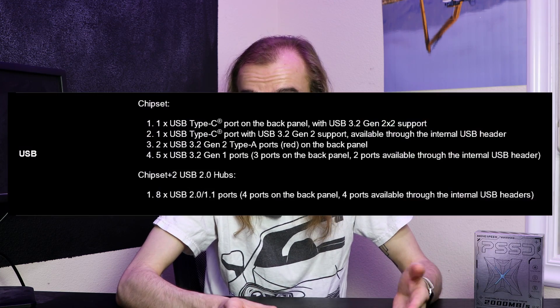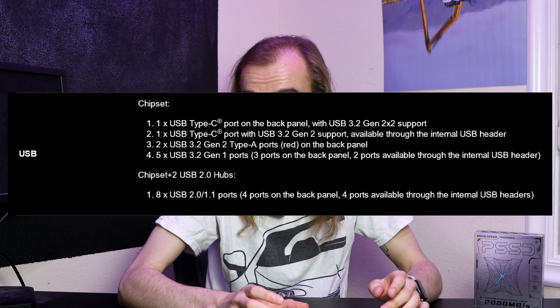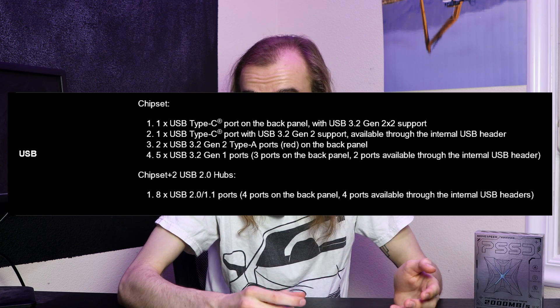Before I look at the performance, I want to make a quick note about USB speeds. This is a USB 20 gigabit drive, or USB 3.2 Gen 2x2. Typically only the newest platforms have this standard, but it's likely to become more common. USB is labeled quite poorly — a lot of systems might only say USB 3.2, which might refer to slower speeds, or some systems have Thunderbolt at 40 gigabit but only support USB 10 gigabit. So double check that your system actually says USB 20 gigabit or 3.2 Gen 2x2, otherwise you're going to see slower speeds.